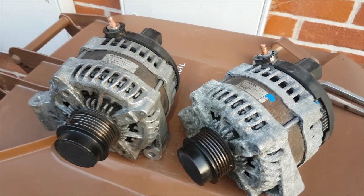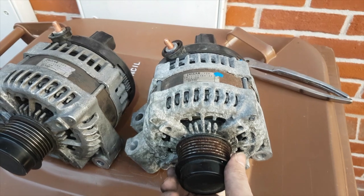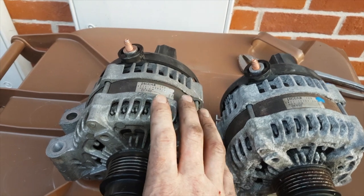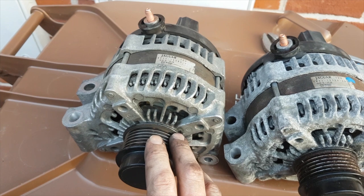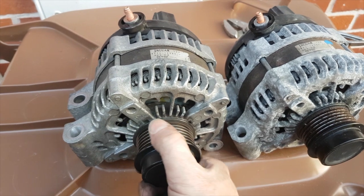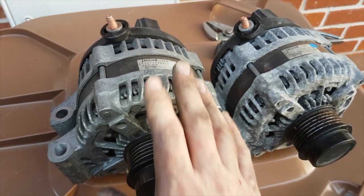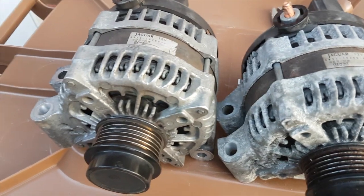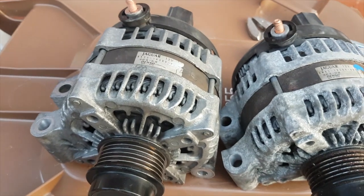So this is the alternator out. I've got this exchange one to put in. It looks a bit tatty, but should do the job. You may see on write-ups, actually, getting this out is extremely difficult. You have to jack up the engine. Be careful not to dent the sump, and it needs a bit of wiggling with a screwdriver. The engine will actually move laterally a little bit as well, and that will enable you to get the alternator out, but it is a really tight fit. But it will come between the sump and the subframe, because as you can see, I've done it.